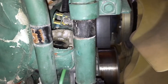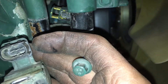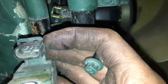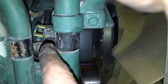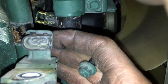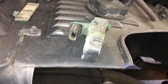I had a Volvo truck come in recently with the same code, and one of the troubleshooting steps is to check the connector. If you look in there, you can see it has some kind of green dust — looks like oxidation. And if you look back at the plug, it has the same thing. I want you to see the difference between before and after I blow them out, because that's what I did on the last one and it solved the problem.